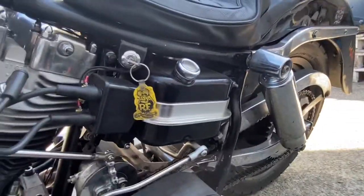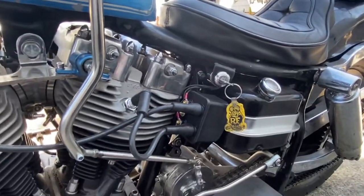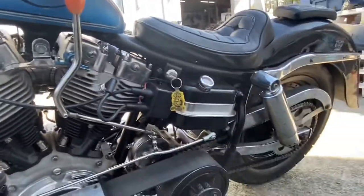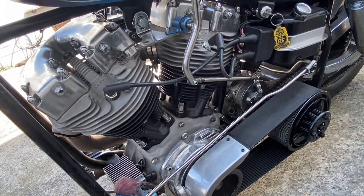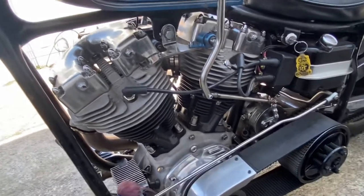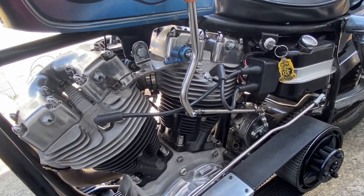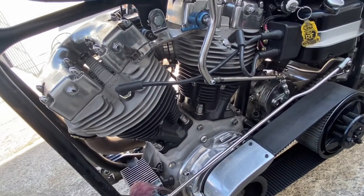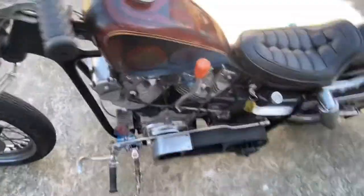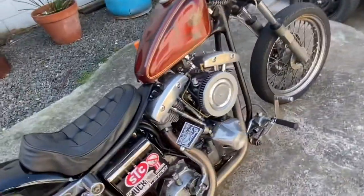Standard oil tank. Ignition mounted there. I've got a Daytona Twin Tec with a charging kit through it. The cases were really flogged out — something was out of balance with the crank — so we sent the bottom end off to LA Cycles and they built that. We put an Evo crank in it, some Wiseco 9.5 twin pistons, and just stock heads with a bit of a clean-up.